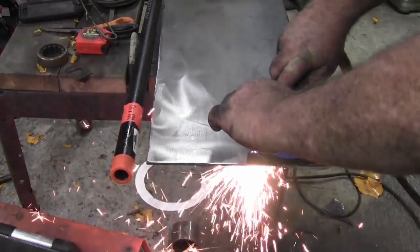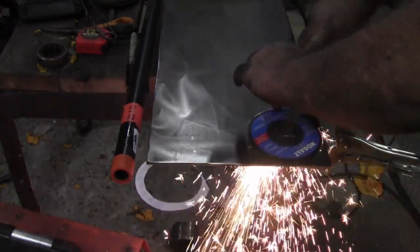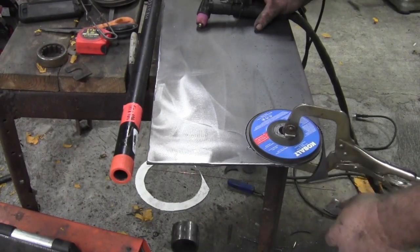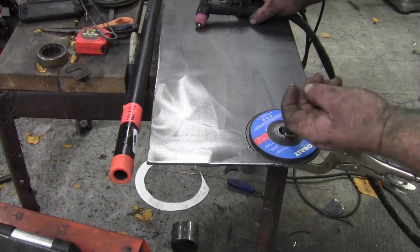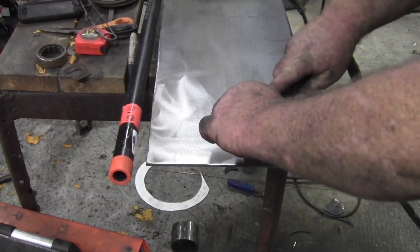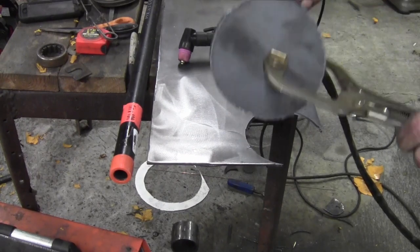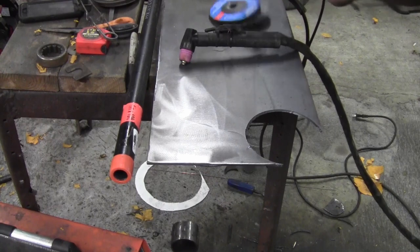I mucked up just a little bit at the start. I meant to start off at the edge and work in — whoo, that's hot, the smell of burning skin. I kind of messed up, I got a little bit there that needs to be cut too. I actually stepped on the torch and mucked it up a little bit. It's got a little bit of undercut right there — you got to be careful and make sure you're cutting straight down. But we'll take that. I'm going to cut the other one out and we'll come back.